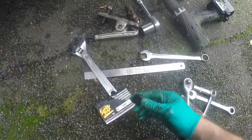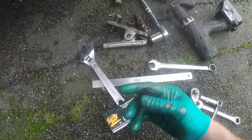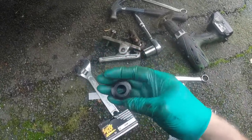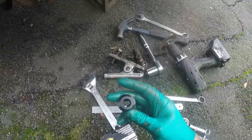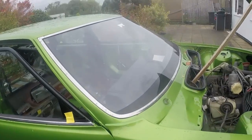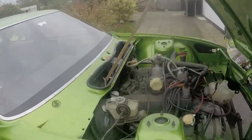I fitted these on one of my cars a long time ago and I was really impressed, so that will go in. I can't remember which way around it goes - it goes from the inside out or outside in - I might have to look at my workshop manual. To get this on you have to split the column from the rack, split the column in the car, slide it forward, put this on, and put it all back together again. So it's not a lot of fun but it needs doing before it runs.